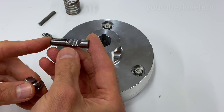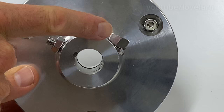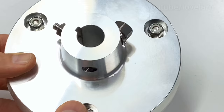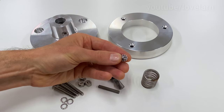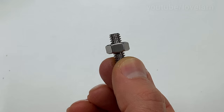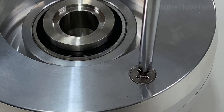Unlike run-of-the-mill cotter pins, the radius of the cutout on George's cotter pin actually matches the radius of your engine shaft, so it will contact a significant section of that shaft once installed. Not all cotter pins are made to these standards — compare this to the single point of contact a retaining bolt makes on the rover design clutch halves. A cotter pin simply offers greater clamping force than Rover's cost-saving dual grub screw solution ever could. The key also registers the slot in the clutch half with the engine shaft, and a locking retaining bolt bears down against the top of the key to hold it in place. This bolt is tightened using the internal hex head, and the washer and nut then bear against the clutch body to lock it in place.